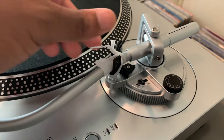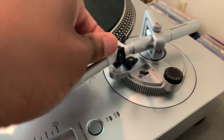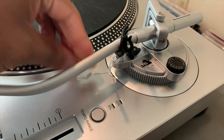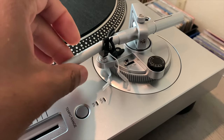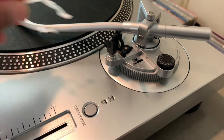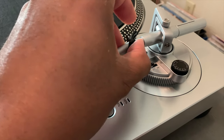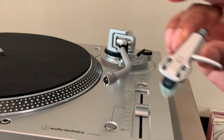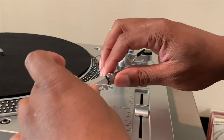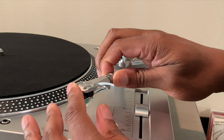Next, we're going to take off the tie that's keeping the arm down — just twist it off and unlock it, then take that white paper off. This is a bit tricky when you're filming with one hand and doing this with the other, but we'll get there. Then put the arm back and lock it in its place. Next, we're going to install the head shell with the pre-installed cartridge — slightly push it into the arm, turn the little wheel, and it will pull itself into place like magic.